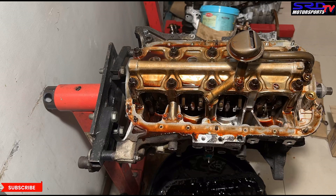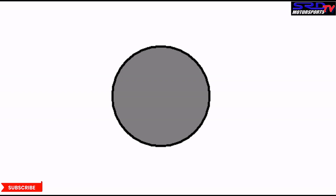While my colleague continues to work, let me talk about piston rings. They tried to tell you the piston rocks, then run oversized rings. Imagine the gray area is the bore and the black line is the piston ring — they make the piston ring concentric to the bore and then expand it a bit. This way when you install it, it pushes out equally all around the bore because it's concentric. The rings push out equally on the same pressure all around the bore — this way it seals really well. This is why checking the bore and ensuring it's straight is important.